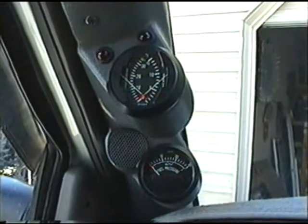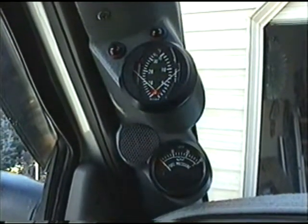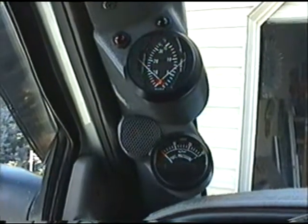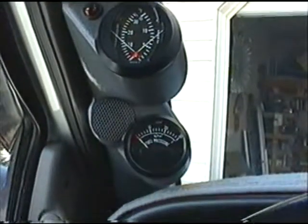And of course the one on the right there is the one that will flash when the fuel pressure drops below about 7 psi, and also a chime will sound. You'll hear that when I turn on the ignition. The chime is located right up in here, right in underneath that. It's a fairly small one and fits pretty good.